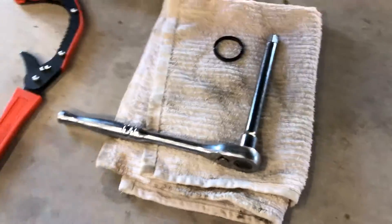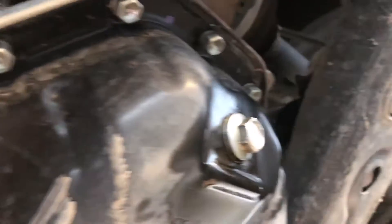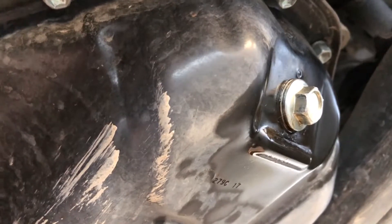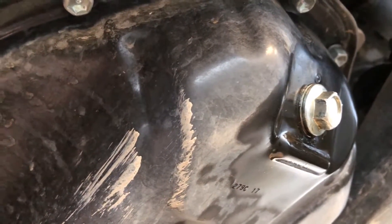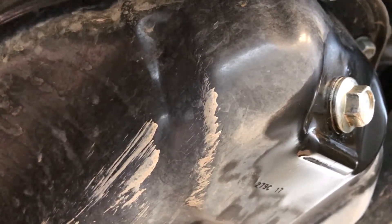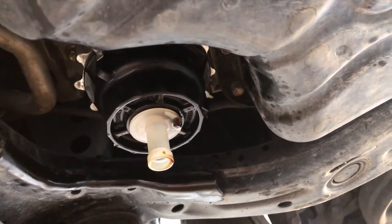Here's your 3/8 with your extension to drain the oil. Right there — that's the oil drain, this is the oil pan. Oil drain is 14 millimeter — either a 3/8 socket with 3/8 ratchet, or a 14 millimeter half-inch socket with the half-inch ratchet.